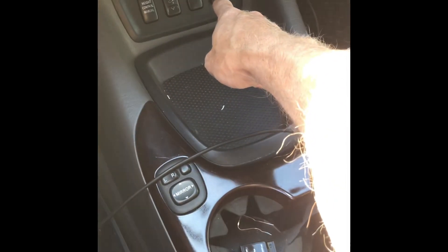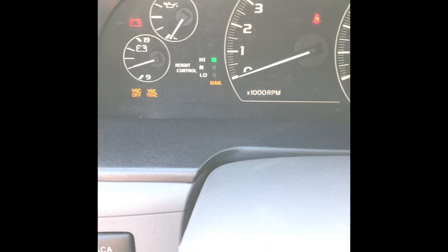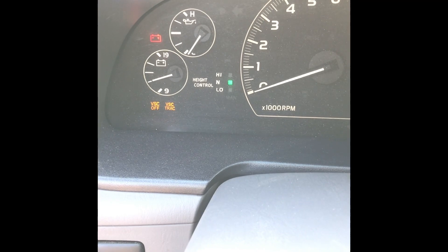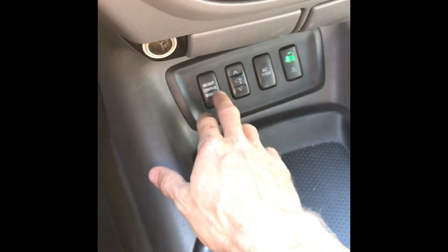Just to reiterate: this switch cuts the fuse circuit, disabling the air ride suspension. You can always tell the system is off when you see the MAN light blinking on your dash. Here's a good example — if I depress that switch it completes the circuit. You can see I have manual on right now, but if I click it off I don't have that height control manual circuit light indicating. If I want to go ahead and depress the height control, I just press the button and I'm on manual now — and you can hear the air is pumping up right now.